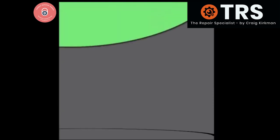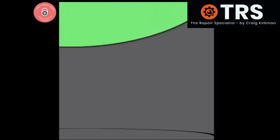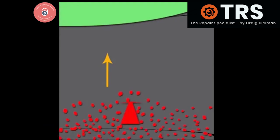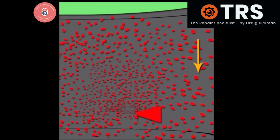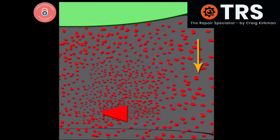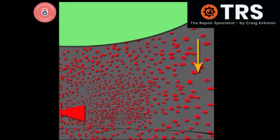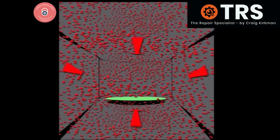This is the fuel pump chamber, and this is what's been drawing us in to this point. The fuel pump diaphragm sits above the chamber and operates as a pump. Each time the fuel pump diaphragm rose, it created a suction pressure behind it and pulled in fuel underneath it. As the diaphragm lowered, it created a pushing pressure, forcing the fuel this way. And any fuel wanting to come back is immediately stopped by that one-way valve flap that we've just come through.